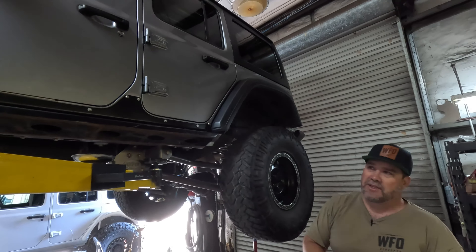With the King shocks and without the extra weight of a spare tire, this thing really does make it through the Rubicon fast and comfortable. You can see our side brackets — some people argue that a long arm exposes the bracket and arms more to rocks, and that is true. There are rock scratches on the lower control arm, but the improvement in geometry, ride, and flex is worth it in our opinion. Chris has proved it — you can go out, beat on these things, and it all holds together.